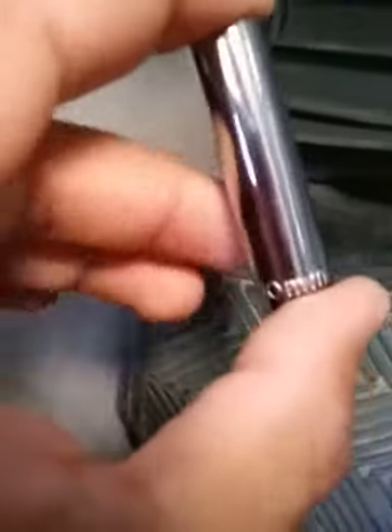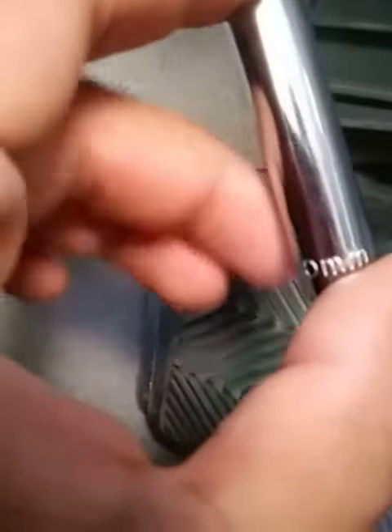This bolt right here is the parking brake adjuster. It comes with two nuts on it — I already took one off. On this car it is a 10 millimeter, so I'm using a 10 millimeter socket. Make sure to get a long one, because once you start going to a certain point the shorter ones won't work — the screw inside is going to hit the inside of your socket wrench. So you tighten this up and it tightens this line.